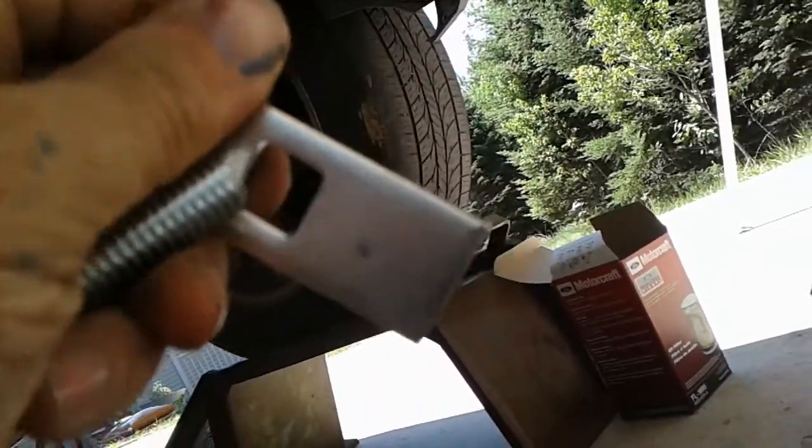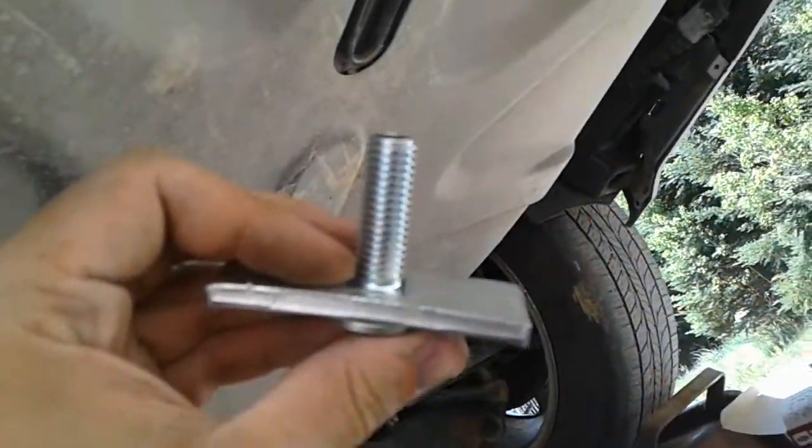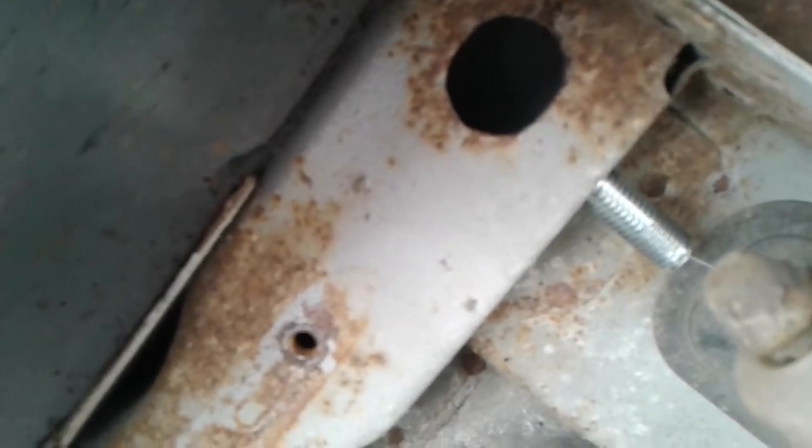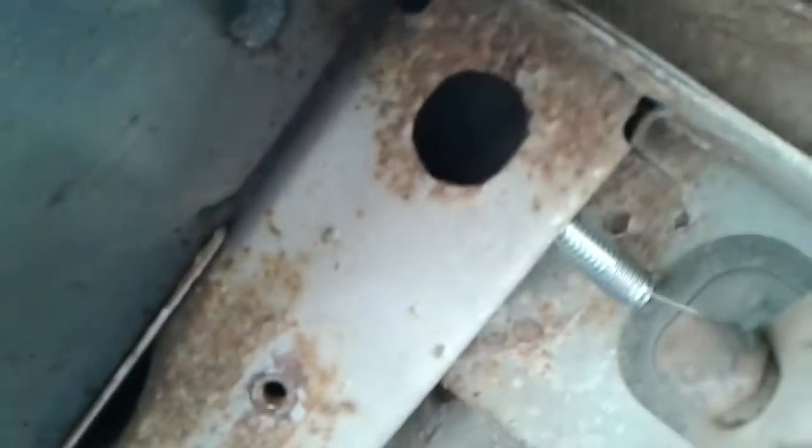You take the spacer block you need and put it down the wire. When you let all that go on the wire, you'll still have this attached at the two points I have here. Those are the only two places you need to do this on the 2008 Taurus X. According to the manual, if you have a 2009 you don't even have to do this — you just run two screws up into it.